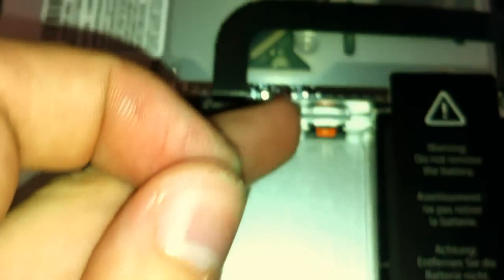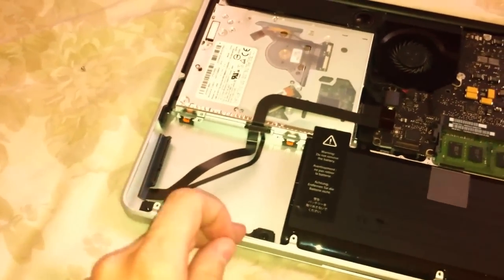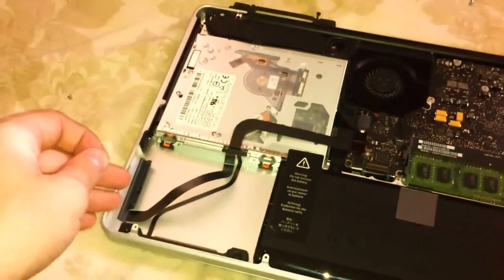Apparently Apple tried being a little slick here — they make it a little difficult to replace the hard drive. The screws on the outside are pretty much the standard Phillips head. But then there was a special way to remove the drive: some screws here, and a little piece that I removed. I had to kind of pop the drive out, take the connection off, and I realized what was holding it in place are these little screws at the end, which locked it in.